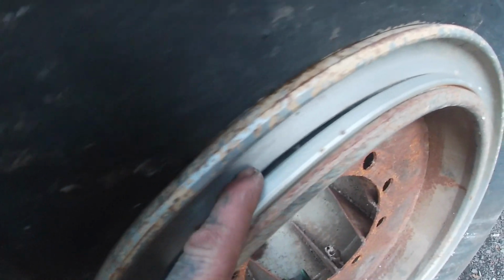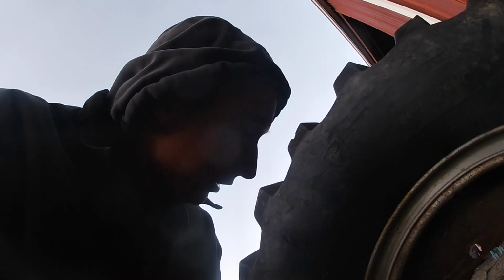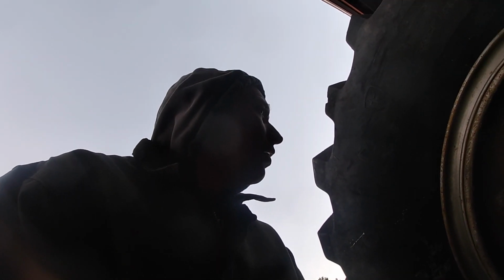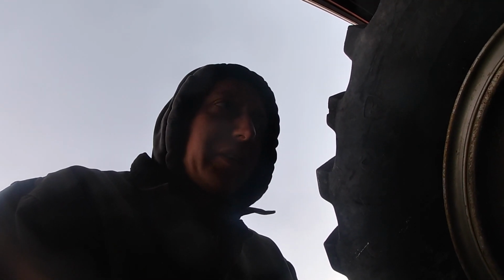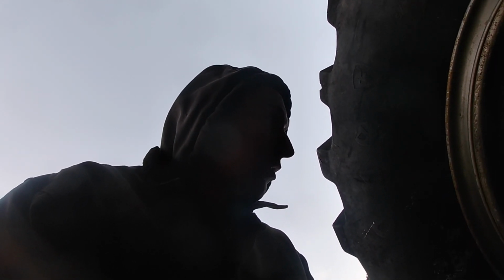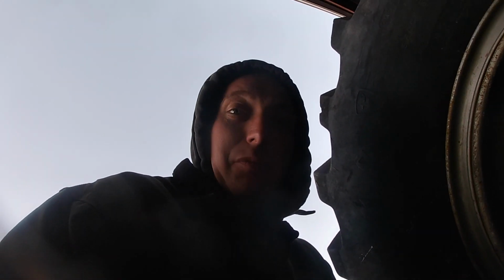It's leaking right here out of this O-ring on the split ring of the wheel. I'm trying to beat it back on. It's not popping in. And the air's leaking out of there so fast it won't fill up. I don't know why the nitrogen tank didn't help, but at least it was quiet enough so it helped me find the leak real quick. I'm gonna pack some grease in there and try and get it to take air.